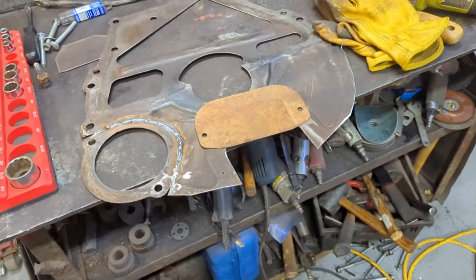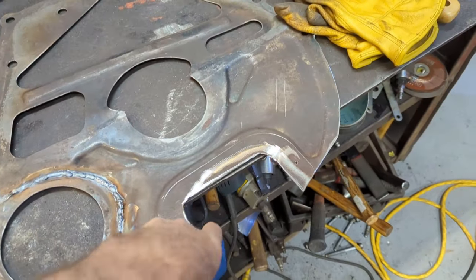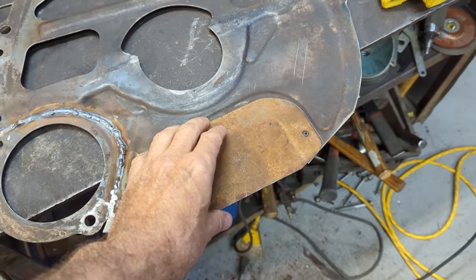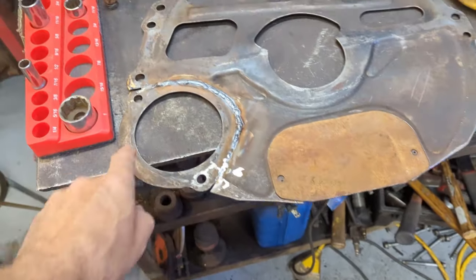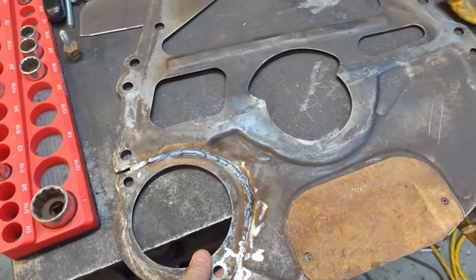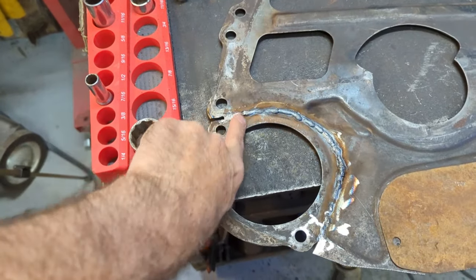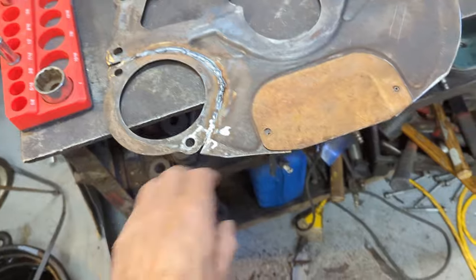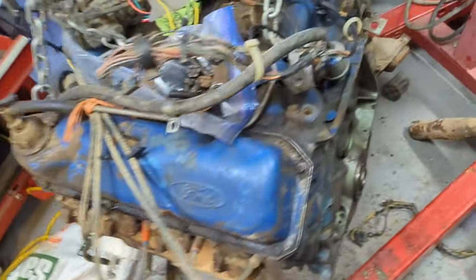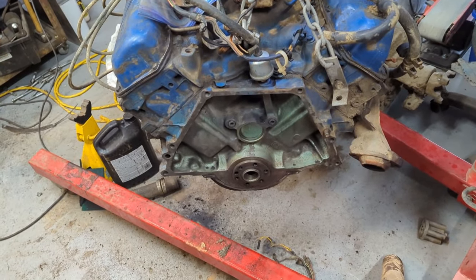All right, I got the separator plate done up. Got the port put in to get at the torque nuts. The plate there, I'll put a couple of self-tappers in when the time comes. I'm not going to grind all this off. It doesn't need to be. It's not touching anything. Also, I did clean up where the mating surface is, but that's good. I've tested it on the back of the engine over here. Seems to fit really well. I tested the starter and checked the clearance.